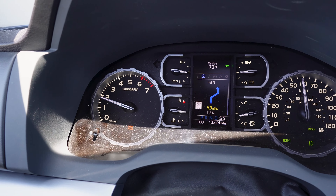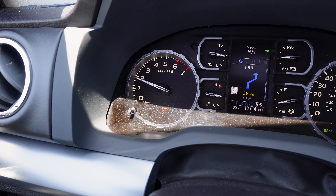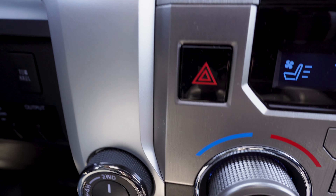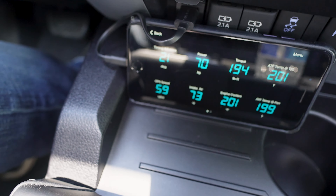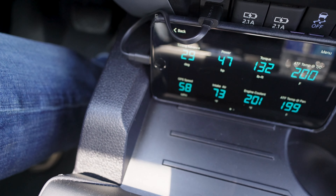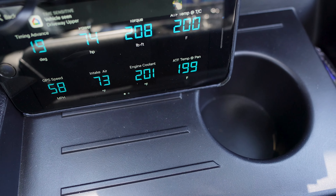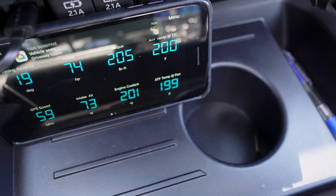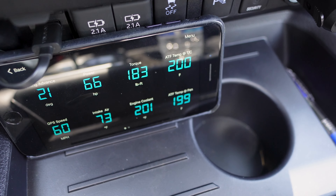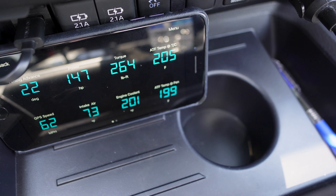Quick overview — settings that work well for me. Would love to hear if you tow with the Tundra what settings work well for you and what your experience has been. Overall I've been super happy with this truck and how it tows — this is a pretty decent sized trailer, 27-foot Airstream for the Tundra. Just wanted to show you guys an example of fifth gear tow — we're doing about 60 right now. You can see the Tundra with the Airstream behind us in fifth gear, torque converter locked. You can see the temperature over there.